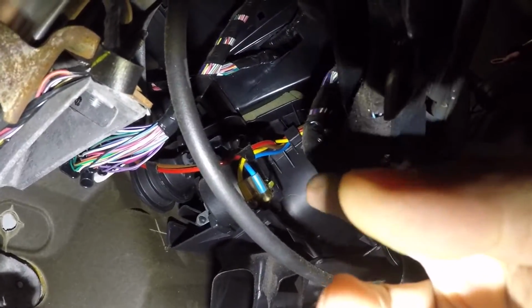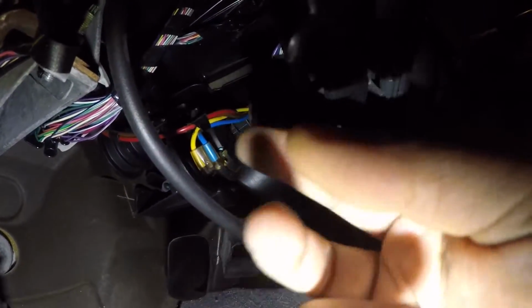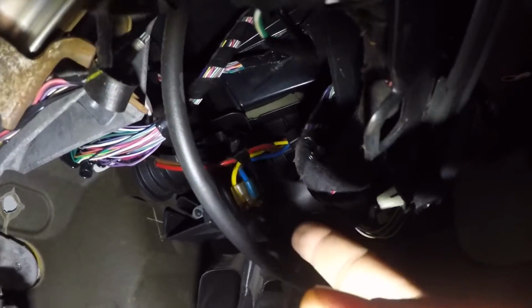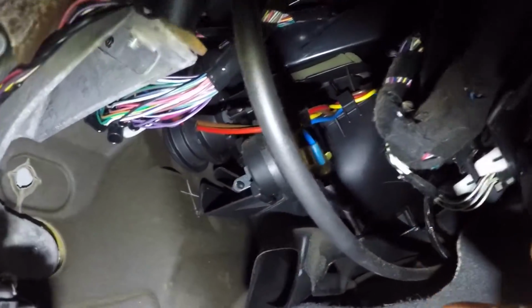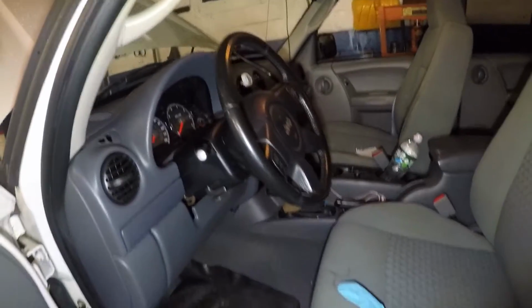So I'm going to be checking the vacuum coming in, and it's very common for these Jeeps for either the motor to go bad or these little vacuum controlled actuators, another word we could use, not working because there's no vacuum coming in, all right? So I'm going to be checking that, guys. So don't go crazy.